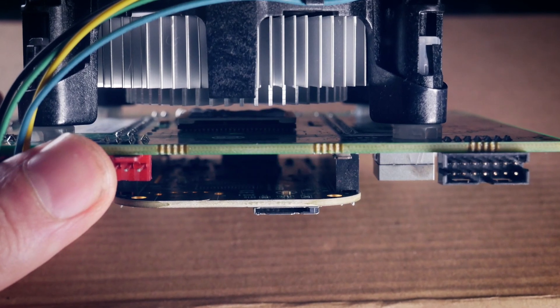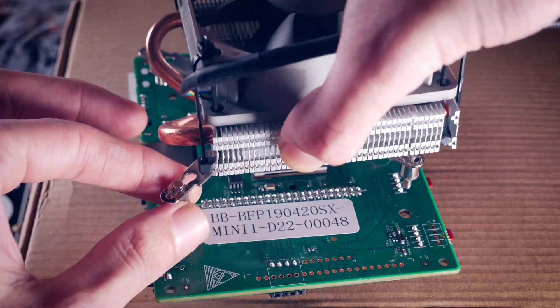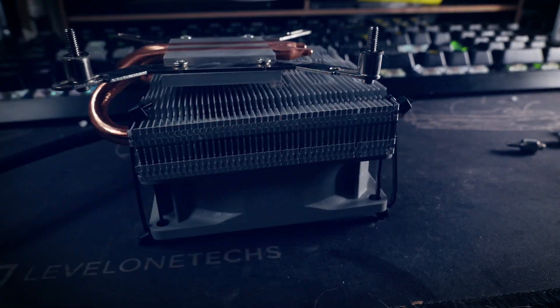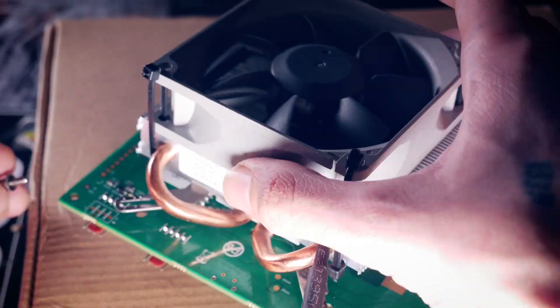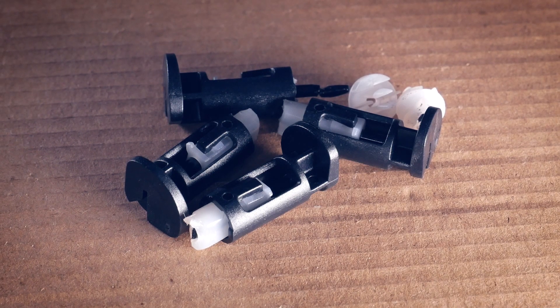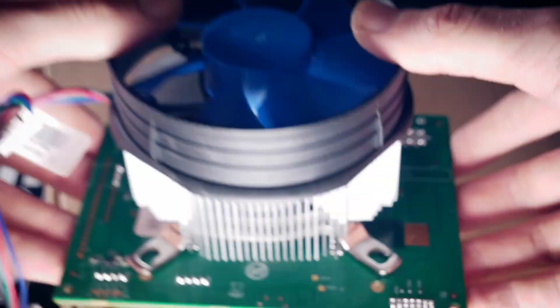Especially the coolers with the plastic mounting screws. I was a bit desperate at first, but then decided to just customize the cooler. I have a spare low profile cooler which also has the plastic mounting mechanism, so I clipped off all the plastic screws and finally the heatsink and the chips do make contact.